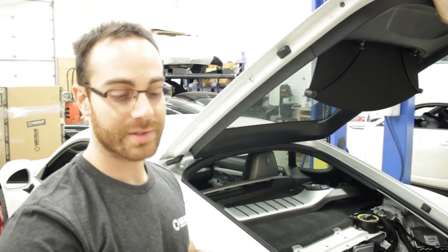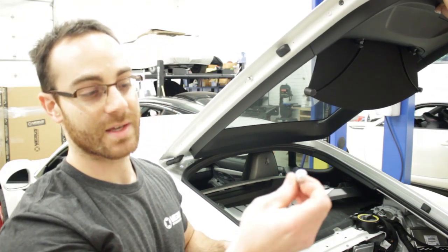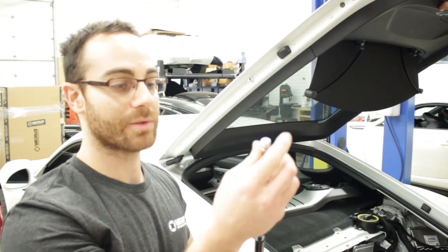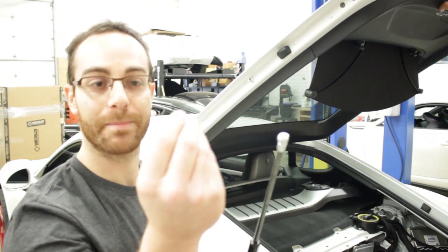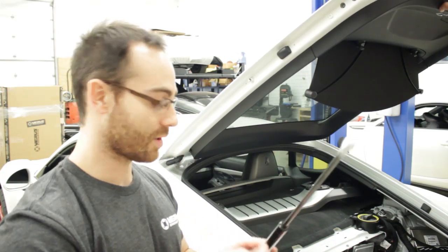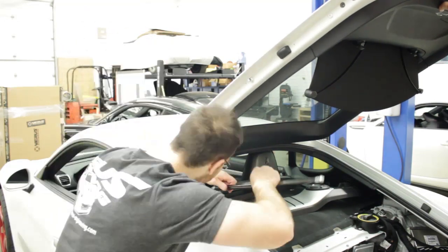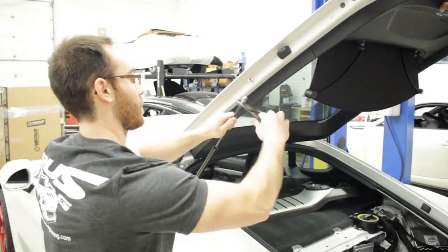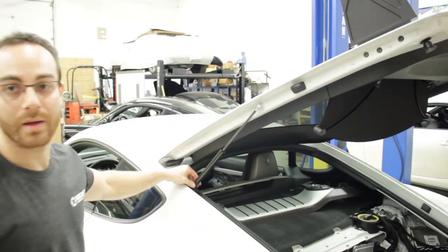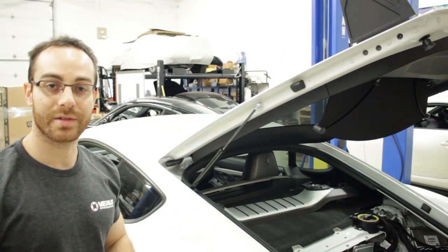To install the units we provide: this is the locking mechanism on the tip — rotate it halfway out and the pin will come out completely. Then install the new hood strut in place.